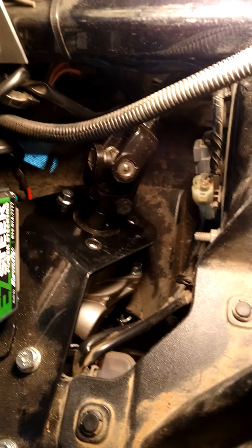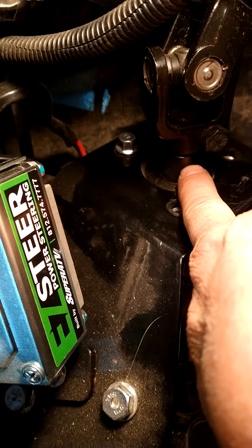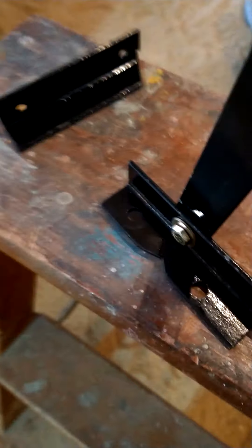So what I did to resolve this issue — I looked around and I just found some angle iron, and here's what I came up with. Just a piece of angle iron. This is going to be for the top — I'll show you that in a minute. Here's this little V cut, which is clearance for the steering shaft. I just took a hacksaw and hacksawed it out, just because I'm at home doing this and not at work where I have better tools. So I made up a bracket and just bolted it on.